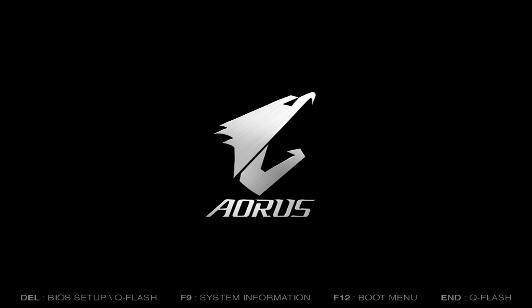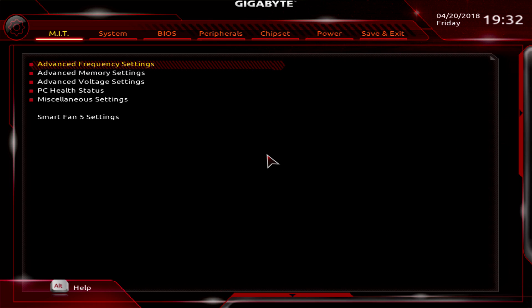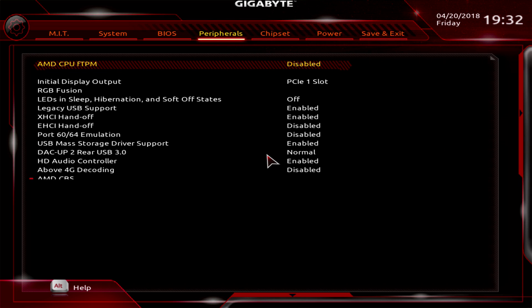While going to BIOS, one thing I want to note: cooling matters by enabling Precision Boost Overdrive. I've used the stock cooler a little bit with this option — it doesn't scale that well. The only task I used while using Precision Boost Overdrive with the stock cooler, the Wraith Prism, is that it was around 25 MHz more on Cinebench. It's actually really sensitive to temperature. Right now I'm using an all-in-one cooler, the Thermaltake Floe Ring 360, for this video.